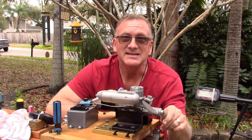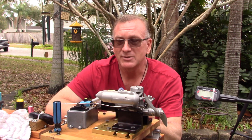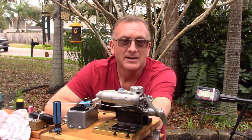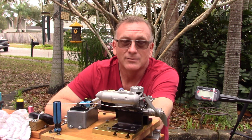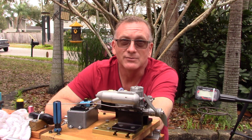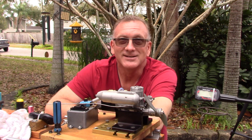You're not going to get to see me retune this, but I've got plenty of those videos. I've got an APC 10-6 prop on here, some SNW 12.5% nitro, and a brand new OS number 8 plug. What I'm going to do now is run it again with the baffle and without the baffle, and also include some static thrust readings with and without the baffle. Let's get on with this run.